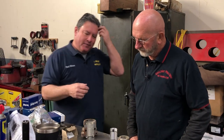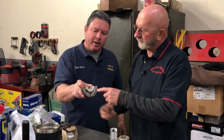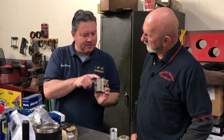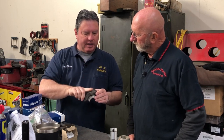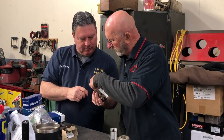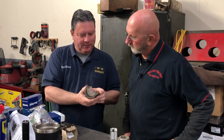Now let's talk about rods. A Model A rod does not have pressurized oiling unless modified, which means drilling a crank and all kinds of stuff. The way they work is there's a dipper — the dipper tray fills up with oil, and as the rods are turning they go down and dip into that oil, which gets shoved between the crank and the rod cap. These are Babbitted rods that haven't been machined yet. You've also got to look at the thrust surface here and this little hole for the oil drain return.